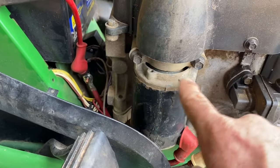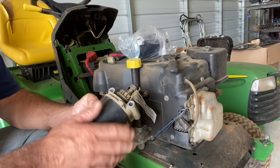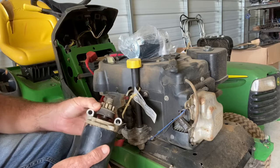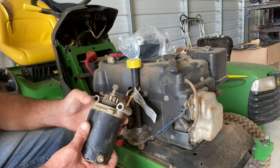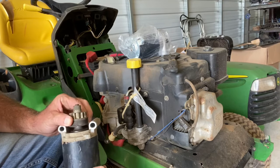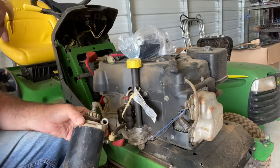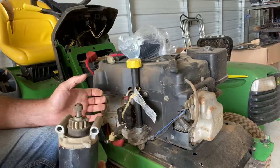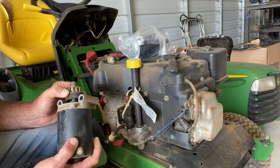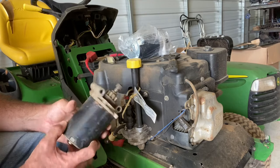You've got to remove two 10-millimeter bolts and I'll put a new starter on — that should fix the problem and we'll have a whole new starting system. When I removed it I noticed straight away that the Bendix was stuck in the up position. What happens is when you energize the key and power gets down to the starter, it thrusts this Bendix up, those gears connect with the gears in the flywheel up here, it turns the motor and fires it off. When you release the key it disengages. This Bendix was stuck in the engaged position, so it was turning the whole time the flywheel was turning. This is a 13-year-old starter.